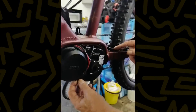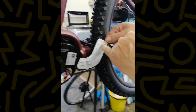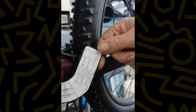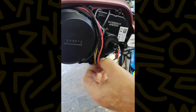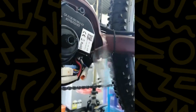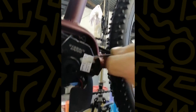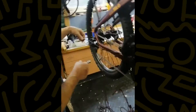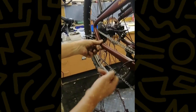Under here is a cover which you open, and in there you'll see all the parts. Pull out the wires gently because you want to try and get them back in the right way. Here's the one that's the gear sensor. When we fit this gear sensor the cable comes through the hole, through there, and plugs into there. You've now got this released so now you pull this out.